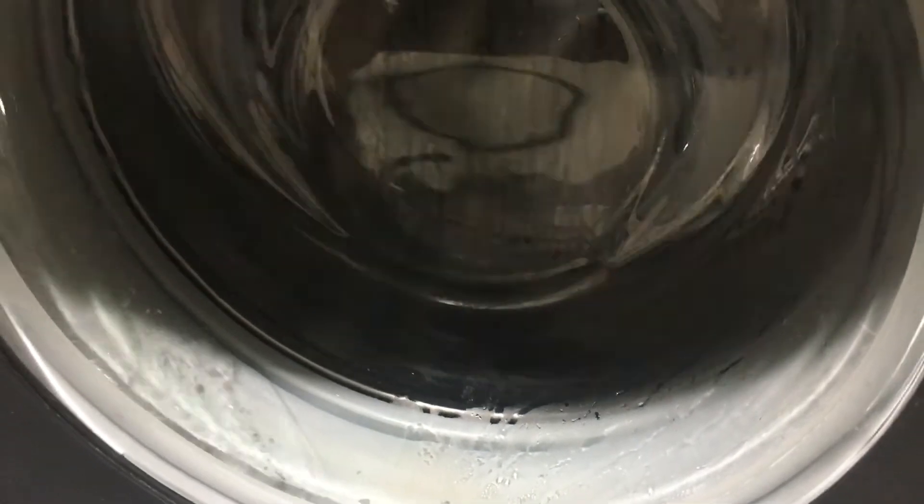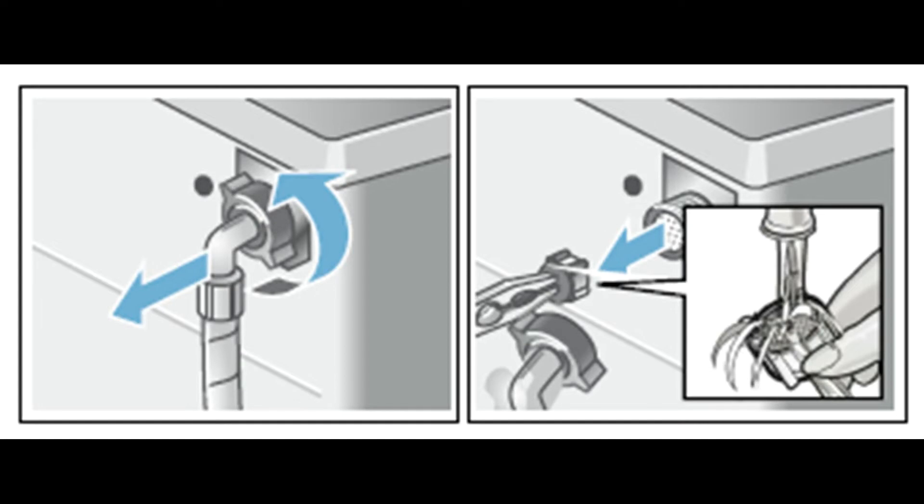You can see it's drawing less water. I just showed the cleaning of this filter. This model also has a filter in the rear which needs to be cleaned if blocked — you have to remove it with a plier and wash it under running water as shown in the picture.